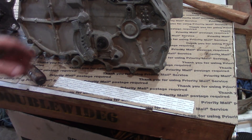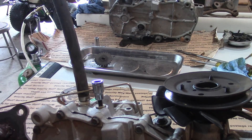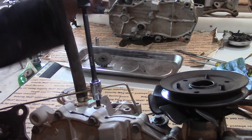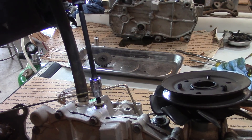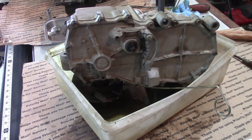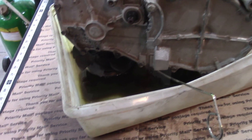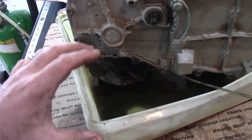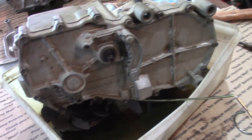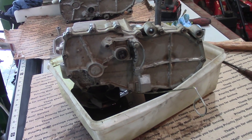First thing is there's a keeper on here — we're going to remove this gear, keeping all left and right side parts separate. You don't have to remove this bolt. Here's your drain plug in case you ever need to add oil. I'm draining it by flipping it over into a tub — it's not a gear oil, I think it's maybe a 40 or 50 weight; I'll confirm once I look it up. Here's your fan and pulley — I put a socket underneath to keep oil off of it. I'll let it drain about 10 minutes. The new shaft upgrade kit is the same for both axles — left and right are exactly the same, at least for my model.